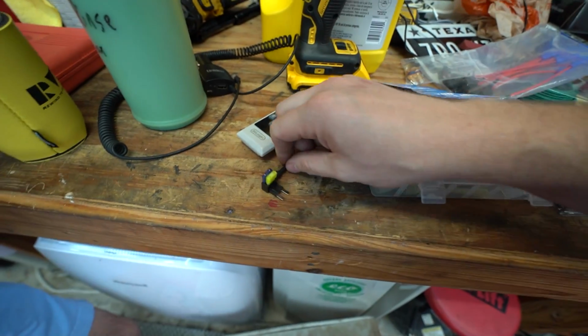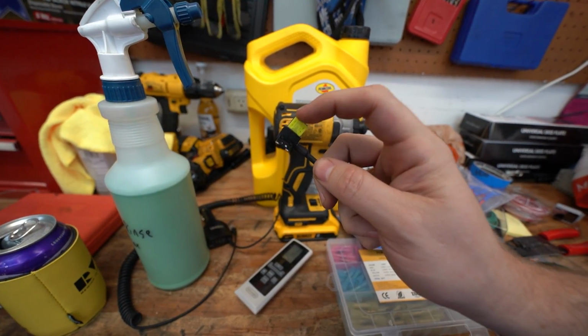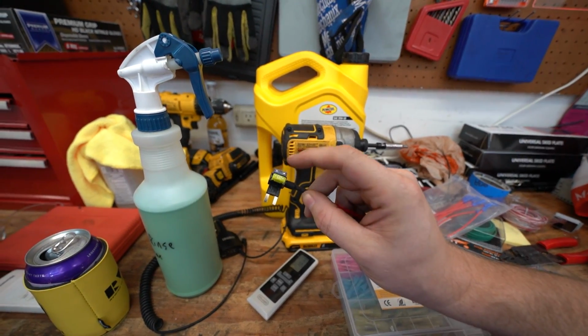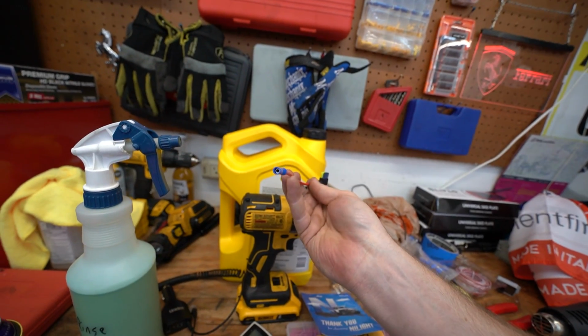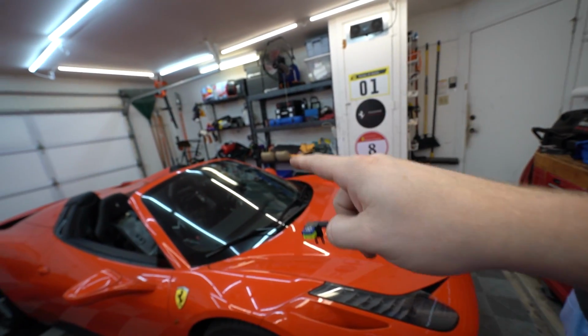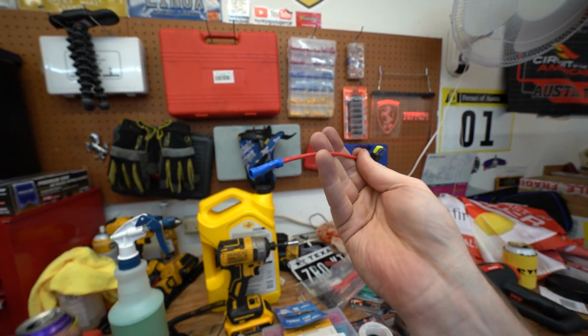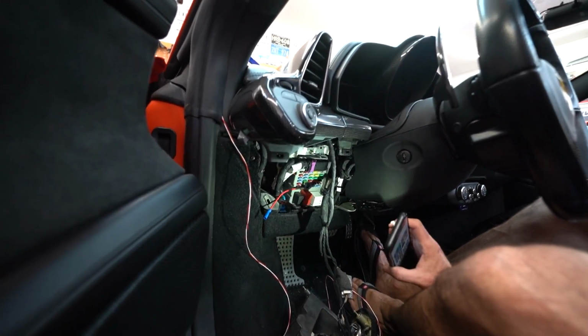That's it. Okay, so we've got our fuse tap, and what you can see is we took the 20 amp that was existing and put it in the bottom one, and the 15 amp that came with the kit, put that in the top. So the 15 amp fuse actually will run our little lead wire. The 20 amp will go to the devices that were already being run off the fuse. So now we take that end and we put that onto our splice. Yeah, I think mine had to run that direction too. Okay, so that's in.